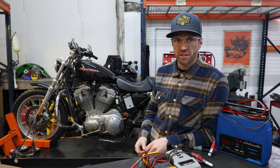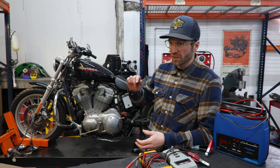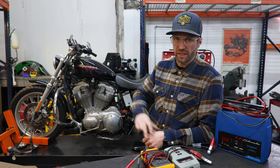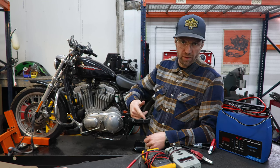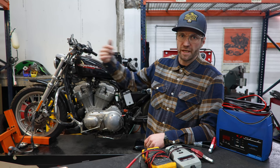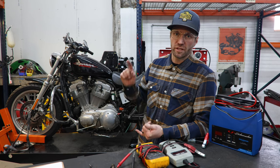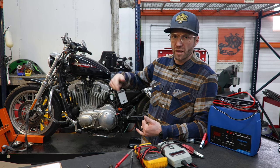So the reason we'd be doing this in the first place — symptom-wise — your bike starts up, you take it out for a ride, make it two, three, ten, twenty miles and it dies flat; your battery is out of charge. You try to start it, you get nothing but a click. You drag it home, put the battery on the charger, charge it up, starts right up no problems. Again you take off, make it X miles down the road, dies again. Those are your symptoms — it starts right up on a fresh battery, but eventually the battery runs flat, either because you've got a bad battery or something in the charging system isn't putting out voltage to keep that battery charged as you're running.